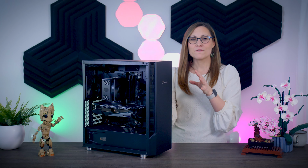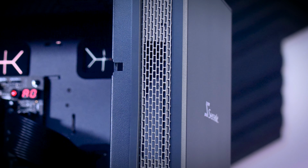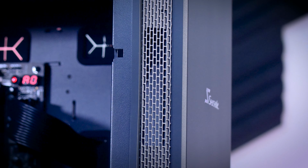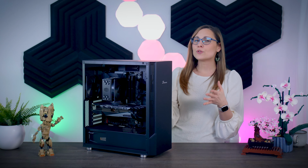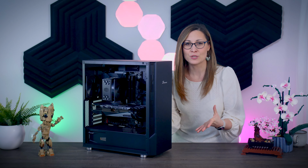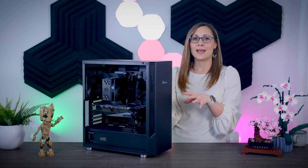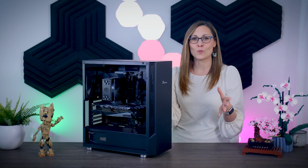Internal temp of 36 degrees is actually better than I expected for a case with a mostly closed front. So the 3 fans that the case comes with and the ventilation on the side is clearly enough to keep a system like this cool enough. Now, considering you would normally combine a 750-watt power supply with a lower power GPU, I would say that the performance of this case would not be an issue in any possible way.